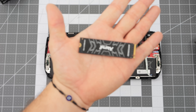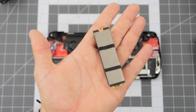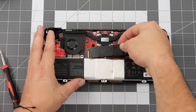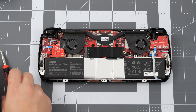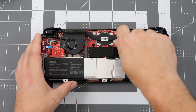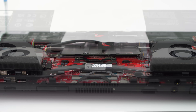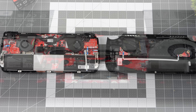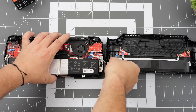Now that we've got the stock drive removed, I can move over to my Kingston Fury Renegade 4TB M.2 SSD. I used a flat aluminum heat sink on one side and on the other side a thermal shield — links for all of this are in the description. This slides right in place of the stock drive. There's actually more room in here than I thought. I opted for a flat heat sink because the battery cable that goes in here needs to go right over the heat sink installed on the M.2 — I didn't want any sharp edges. It fits in here perfectly even with that aluminum heat sink installed. Everything does go back together nicely, but remember you will need to plug in the rear ribbon cable before reassembling.